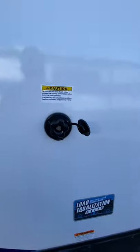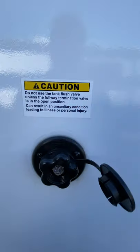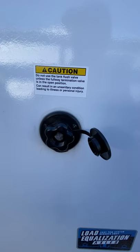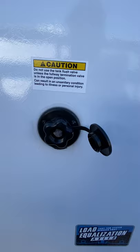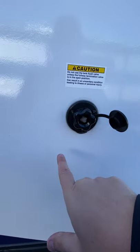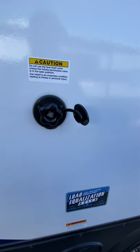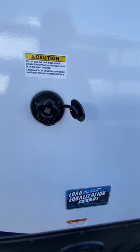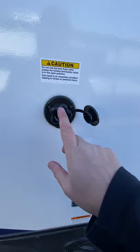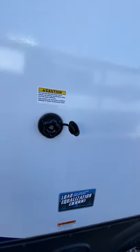Coming over here, this is to clean up our black tank. As the caution sign says, make sure you have your valve open on the black tank before you hook a hose up to it. What will happen — you hook a hose up, it's going to jet out that black tank and help get any of the sewage out of that tank. But you've got to make sure that valve is open for the black tank. Otherwise, water will go in, there's nowhere for it to go, and it'll come up through the toilet. So if you're going to use this black tank flush, make sure the valve is open on the other side.